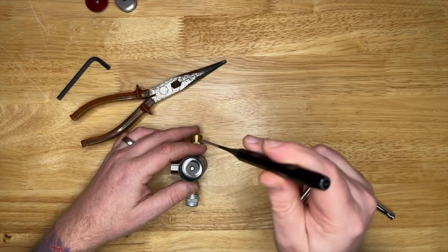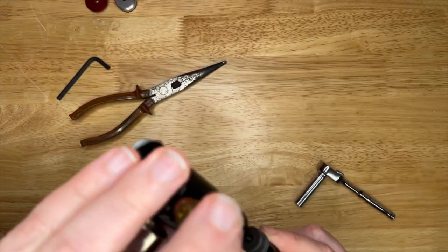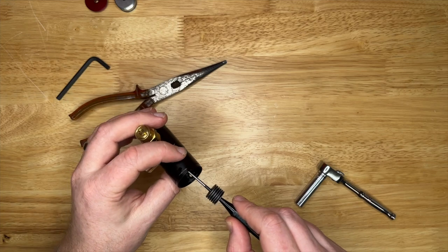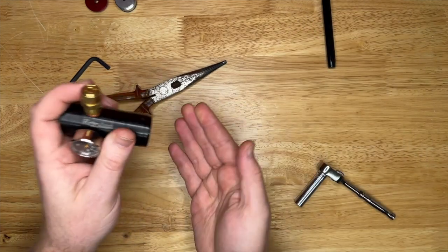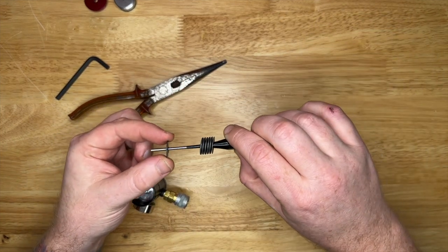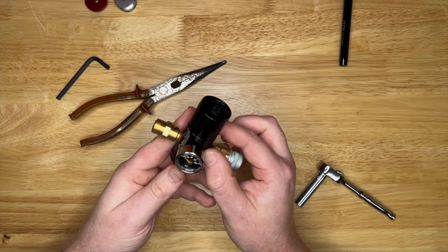If you do screw this bit up, you'll need to read the manual and rebuild the shim stack, which will feel like an eternity. What I'm going to do is put my punch on the silver pin and tip it upside down - and the shim stack comes out. There's one shim left stuck to the grease, so I'll just put that to one side. I can get my stack of shims and put the end into my punch roll so they don't go anywhere.